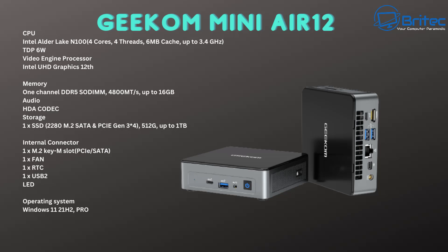The drive in this one is an M.2 2280 PCIe Gen 3 SSD. The memory unfortunately is only single channel DDR5 SODIMM at 4800 MT/s, and up to 16 gigabytes can be put into this device.